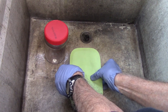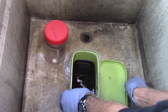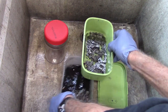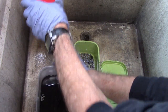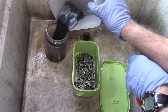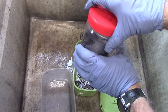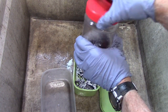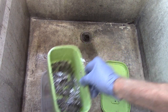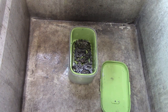After about half an hour, we'll remove the lid and the colander, and pour the degreaser into a recycled container and put that aside. Place the chain back in, and we'll go ahead and rinse it. Be careful not to lose our master link.